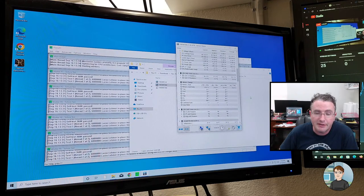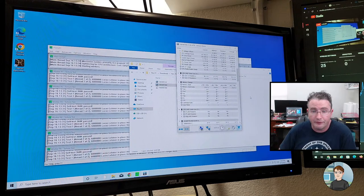I'm pretty sure it was fast boot that my friend Israel had a problem with. He had a system that every time he told the computer to shut off, it would just restart. I'm pretty sure turning off fast boot fixed that problem. But I'm not familiar with all the different problems that it can cause.